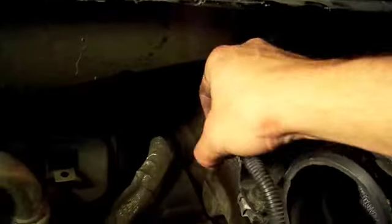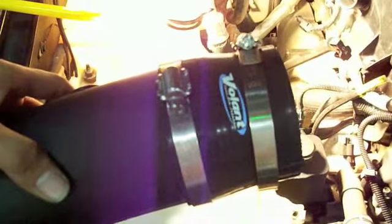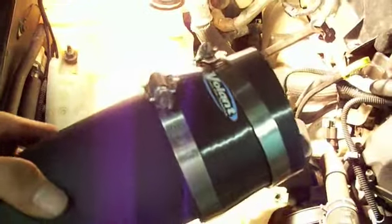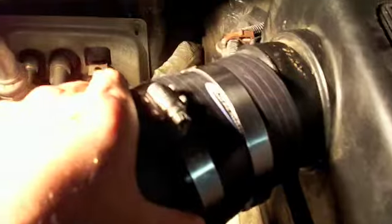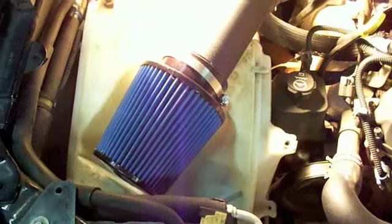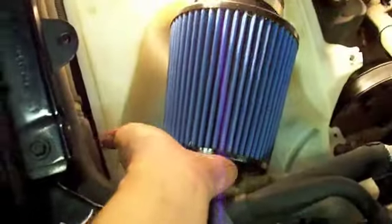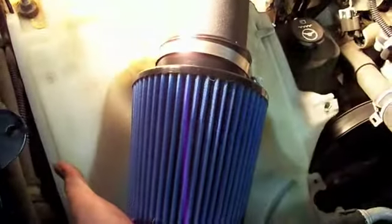The Volant intake tube — I already got the rubber grommet attached with the small end toward the resonator and the two clamps. Put it in, kind of slide it over, pull it out a little bit, slide it over, and tighten it down. The filter was kind of hard to get on — ended up having to put my chest on it, push it on, and then wiggle this part here to get it all adjusted.